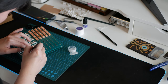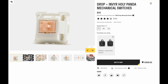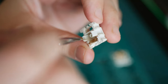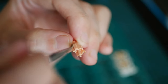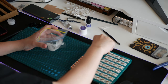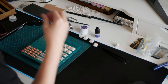Obviously people take lubing seriously when it comes to keyboards. So the next thing I did was lube up my 65 switches. I picked up the very popular Holy Panda switches — some very popular tactile switches — and these were off Drop for $85 for 70 of them. First I used my cute little switch opener to pop open the switch, and I did this 30 times. Afterwards I went in with Tribosys 3204 and lubed the inside of the housing — on the stem rails on the side and on the floor — and then lubed the stems. I deliberately did not lube the little legs because I still want to feel the tactile bump. Then I bag lubed all of the springs by putting them in a bag and dripping in some drops of Krytox oil, and shook it all up until evenly coated. This sounds like marinating meat. Then I put all of the switches back together, which was very satisfying.